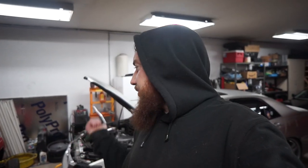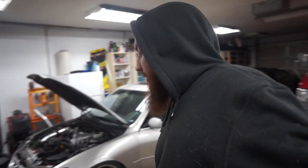I also realized while investigating and finishing this up that if you have an O2 plus, you actually don't need to do this. All you got to do is get a manual ECU and then your harness plugs right in. They change after O1. So everything I was saying about, if you have an O2, you need to look it up. Now just get a manual ECU, plug it in your harness, you're done. That's it. It's plug and play and super easy to go.